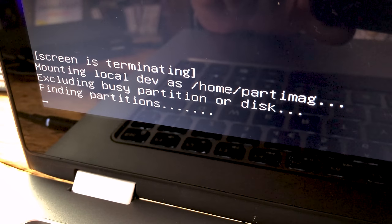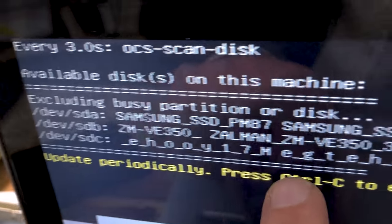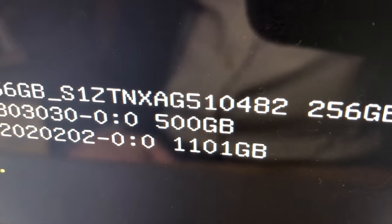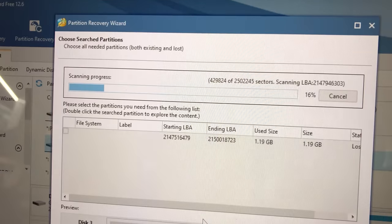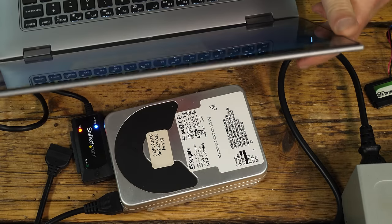I fired up the Clonezilla boot CD and it found the drive again, but fell over identifying any partitions — so Windows, you have been redeemed. It's also identified as a terabyte drive again. There weren't any grinding noises from the disk itself, so I wonder if it's just the controller board that's at fault. As a last ditch I tried partition recovery on the 1.2 gigabyte area identified on the drive back in Windows, but it found absolutely nothing. I'm going to put that disk to one side — if another comes my way I'll swap the PCB and see if we can recover anything. But just like the monitor, this won't hold up our build. We've got our disk on module, and it's going to be a case of installing from scratch, hopefully made easier by the Packard Bell Master CD, which I think I've managed to source a copy of.